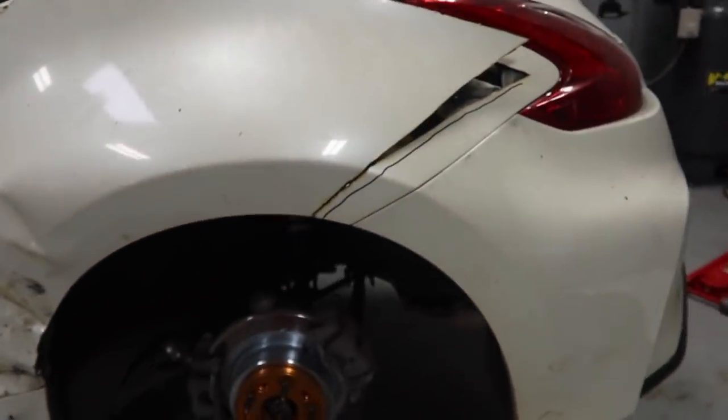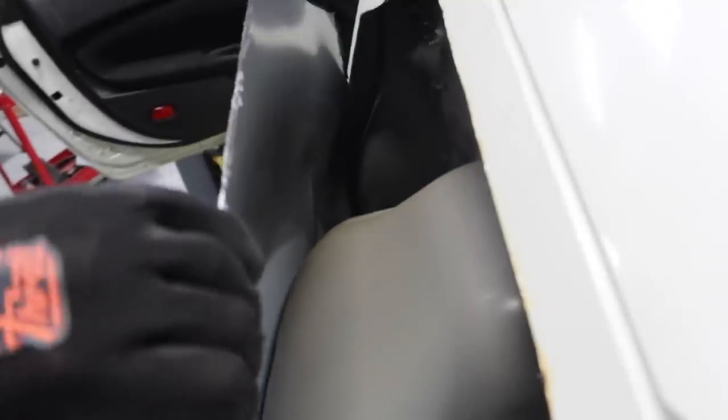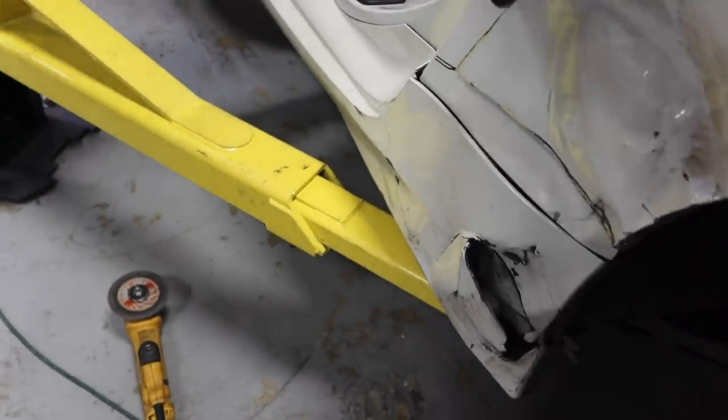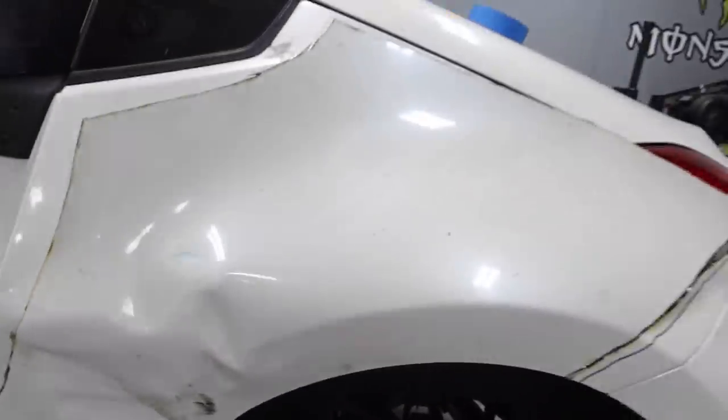For the most part this piece is cut out — it's just glued on the underside of the fender well right here. You can see it's all kind of glued in there; there's two layers. We'll get the cutoff wheel, shimmy that off, and this whole piece should come out in one piece. Then we do some trimming work and we should be good to mount.